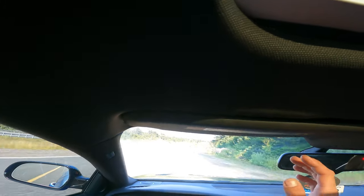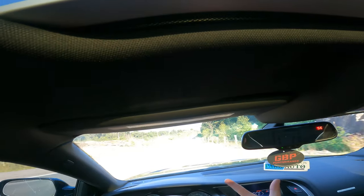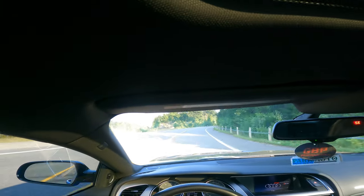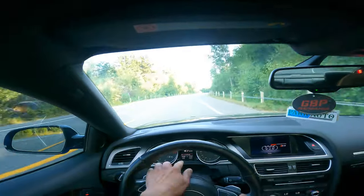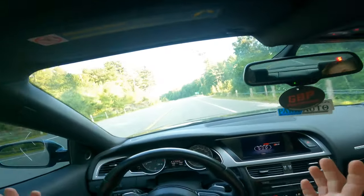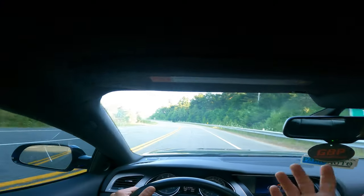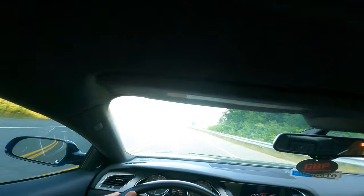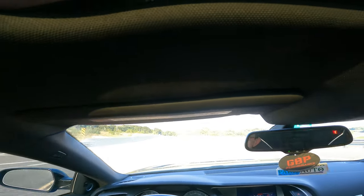Some things to watch out for are common Audi items: your PCV, water pump, and thermostat. Usually when pulling the supercharger off, people replace those and also do a carbon clean — around 100,000 to 150,000 miles. We're at 190,000 kilometers, so most preventative maintenance has likely been done. Supercharger pulley belts look brand new. We did transmission and oil service and spark plugs at 180,000 kilometers.